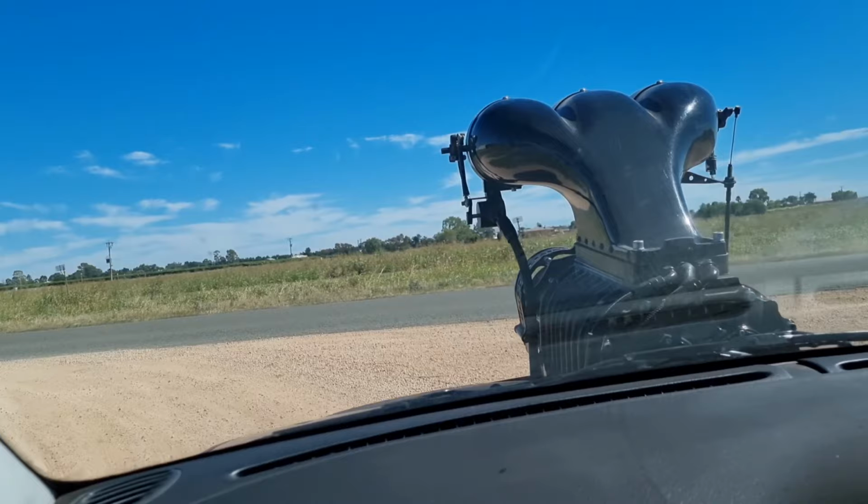All right, guys. Sorry, I didn't film putting this in, because I'm stupid. So it's all back in, all tightened up. It was a 14 mil bolt we put in, instead of the 12, and we recut a thread in there. It's all locked up tight, it ain't going to move, because if it hooks up, we don't want it ripping the threads out of them. If you only put three in it, that's just rough anyway, isn't it, Mick?